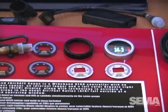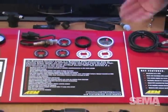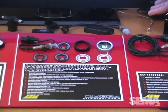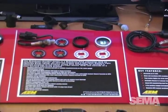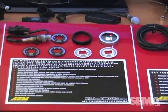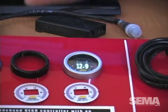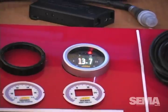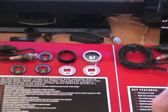It features a very elegant organic LED screen versus our standard digital screens, with sweeping organic LED on the outside — and as you can see, it changes colors. We've got interchangeable bezels and faceplates. But what's really cool is it takes wideband control to the next level. Once you've set your air-fuel ratio parameters, it monitors the relationship of your air-fuel in relation to boost or vacuum pressure. You can trigger an output — in simplest terms, if you run lean for a certain amount of time, it triggers that output so your motor doesn't blow and you don't burn up a piston. If your car runs lean, it'll save your engine.